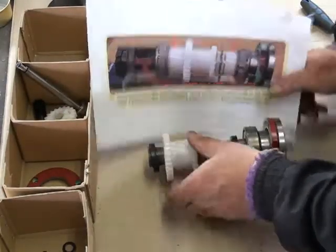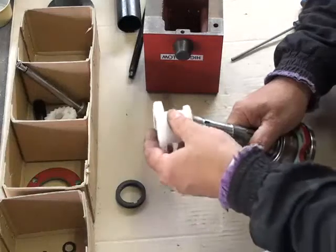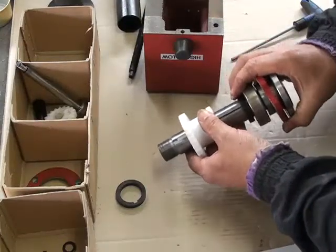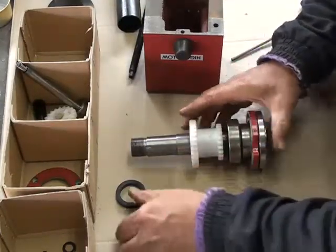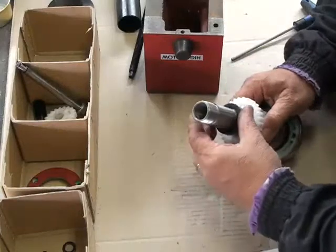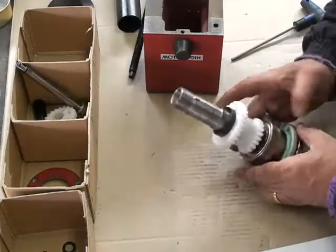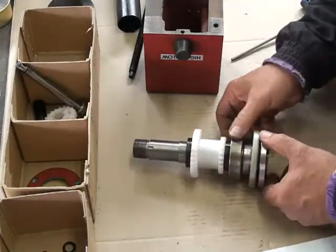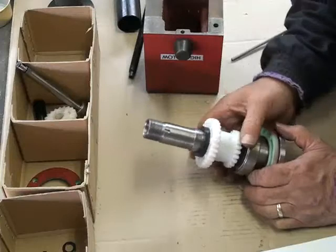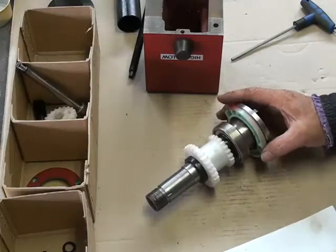So the way it came out — this is quite tight on this shaft. There's the keyway there, and that's going to line up with that keyway there. This one came out of here and it's got to line up with the keyway as well. Well, you can't see the keyway so it doesn't matter — it just rotates. That's one bearing; it's going to be replaced with the bevel bearing. That's how it was assembled inside the spindle box.